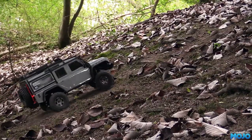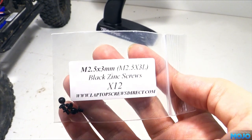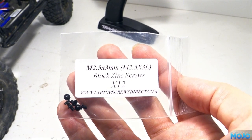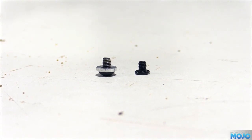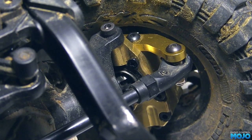And that would be it for this week, but I've just got some fancy screws to replace the short ones holding the bearings in the hubs. They're M2.5x3mm wafer heads — called so because the heads are wafer thin. The diameter is a little bit more than the Traxxas dome heads, and it's just enough to keep the bearings in. And because they're nice and thin, they're not really going to limit the steering lock. I'll stick a link in the description to the eBay listing.